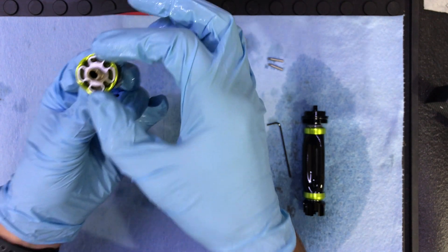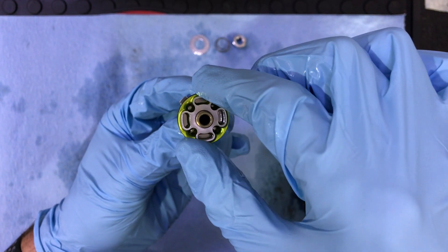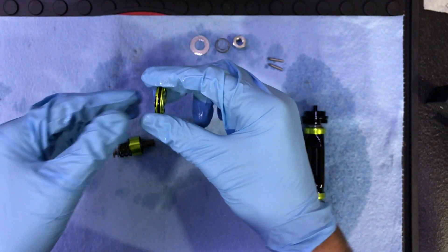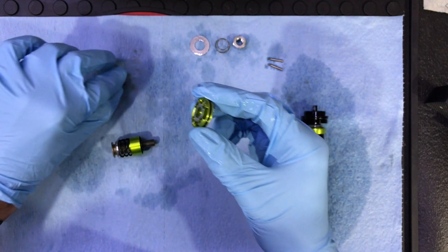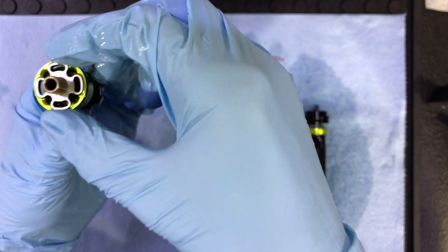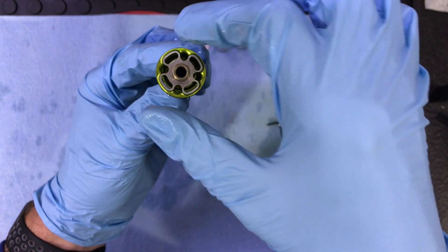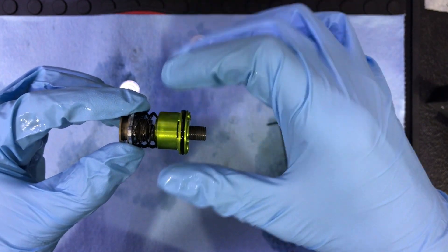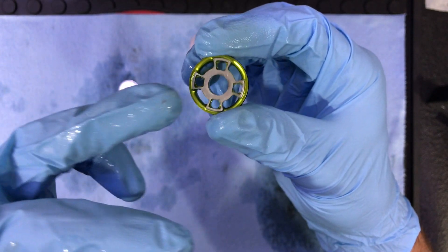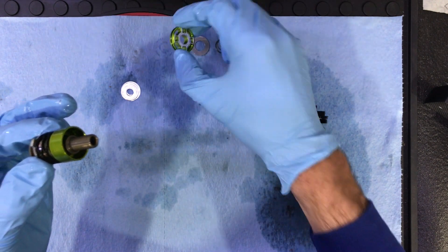Now if you look at the piston, you'll notice this side — the silver piece is rounded and looks a bit like a four leaf clover. I'll make sure the shim stack doesn't fall everywhere because it's very important what order those are in. The stock position is with the four leaf clover shaped rounded ports facing away from the shim stack. The squared, more right-angle looking silver piece is the part that faces against the shim stack. You can very easily put it down and forget which way it goes, and it makes a big difference — I'll talk more about that later.